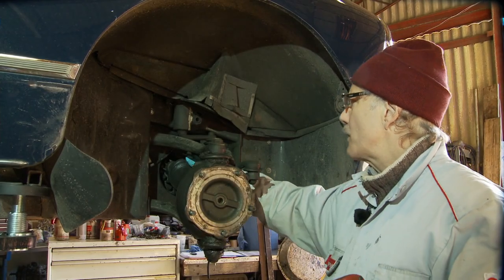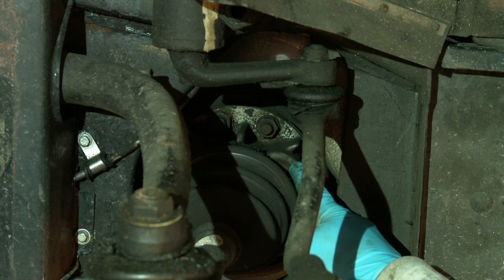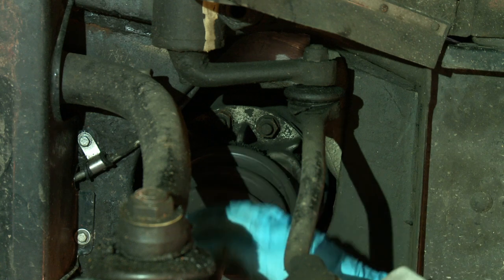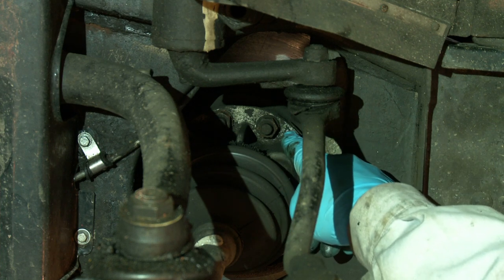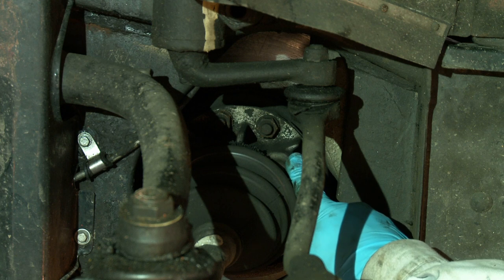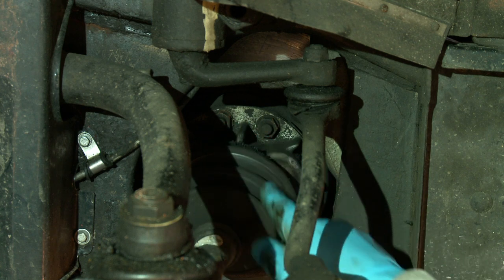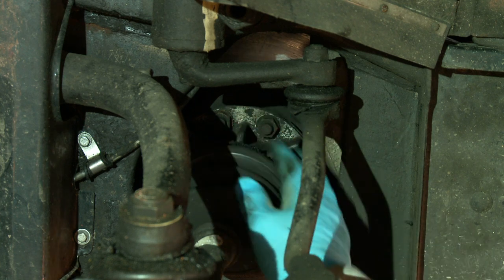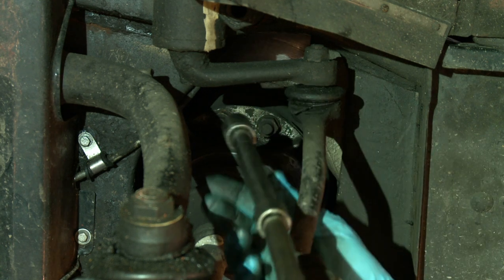We're going to remove the nuts holding the triax of the drive shaft onto the brake. Here is the triax, which is part of the drive shaft, and this is the triax housing which holds the balls allowing the drive shaft to articulate. It's bolted through the disc and into the gearbox, held with nuts done up pretty tight. On early cars — this is a pre-67 car — you can access the nuts directly from the front, which is why I'm using a windy gun and socket rather than a spanner.